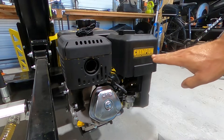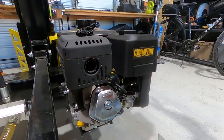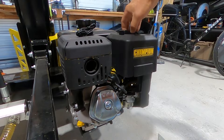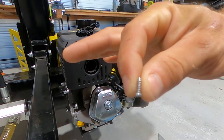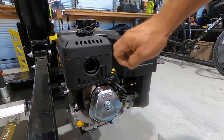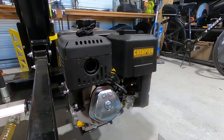I'm going to drill holes for these screws to go through the two holes. You need to take this cover off first because there's an air filter in there and you don't want plastic shavings getting into the carburetor. I'm going to mark these two holes and drill them. The screws it came with — I don't really feel comfortable using those because they're going to vibrate loose since engines vibrate like crazy. I had some better ones with washers and lock washers, and I might even put some threadlock on there just to be safe.